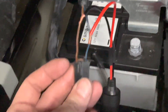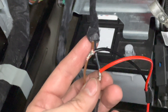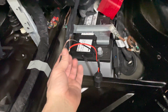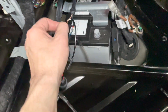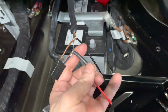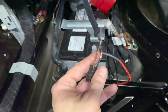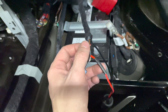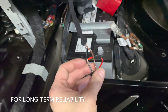Obviously, if you've never soldered before, I recommend you go watch a soldering video. They're soldered — that's a permanent connection there. I have a little bit of heat shrink that I'm going to lower all the way down to the base and heat shrink it. It's not doing much — it's just giving some additional protection. Then we're going to put liquid electrical tape on this and let that completely dry. After that's sealed, I'm also going to do electrical tape around both individually and then both together to combine into one system. That is guaranteed you're not going to have any issues.